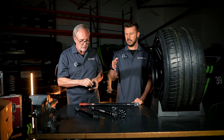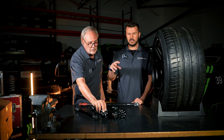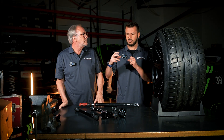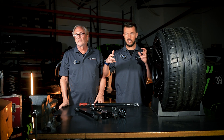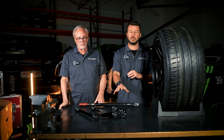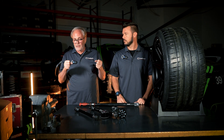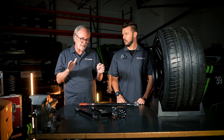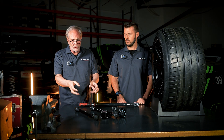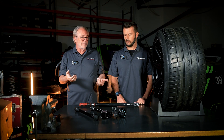That's a great point about the car snaking on the brakes. With modern anti-lock brake systems, once a wheel stops the system releases the brake to let it turn again — the function of both wheels locking independently can also make the car start to snake down the road, and this will help combat that. So if you're adding wider, stickier tires with more grip and lowering the car and adding camber — putting a lot more load through the suspension system — this lets you control that load and stop bushing deflection so the car is stable and fun to drive.